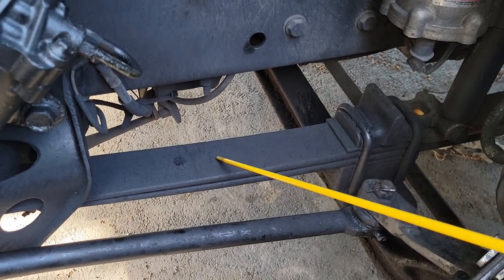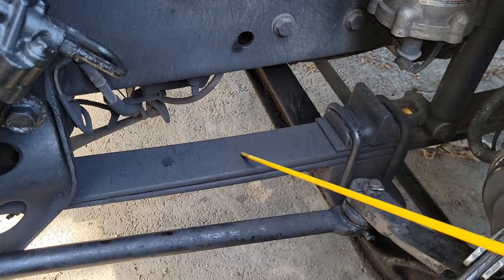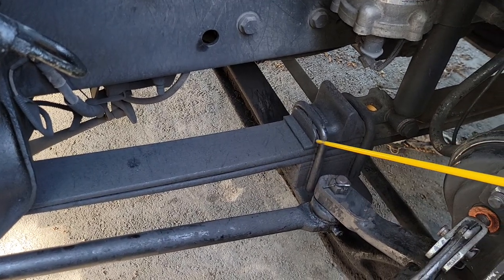Your leaf spring is not scissoring, not bent or cracked, no rust, no illegal holes or weldings. And your leaf spring is tied and secure to your U-bolts.